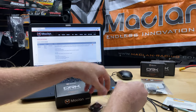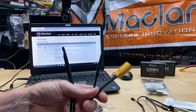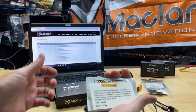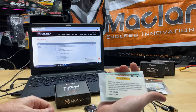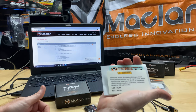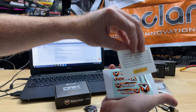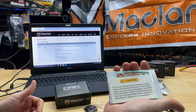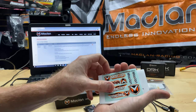It does come with a little fan — you mount that to your speed controller, and it comes with the hardware. I did solder my own XT90 plug on there. A little bit of the instructions do forewarn you: if you run on 3S they give you the 20/80 when it comes to your gear ratios, so you want to check that out. Also, as far as running this thing, only do about two passes and then let it cool down — they say to recharge your battery. You get some cool little stickers with it as well.